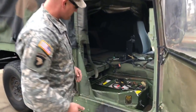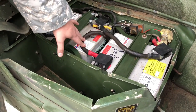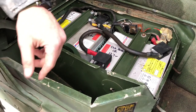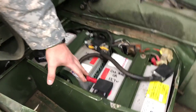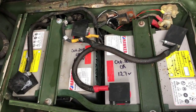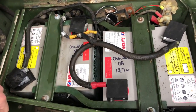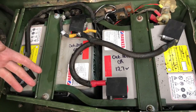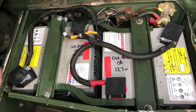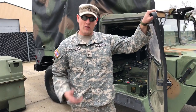Now we can get to the batteries. These are the military-style batteries — I'll link in the comments where you can find these. If you look down inside here, you can see how the battery cables are arranged. You can take regular civilian 12-volt top-post batteries and stick them in here just to get the truck to run and get it to move or pull off the trailer. Just stick two batteries in there, wire them in series, and you'll have 24 volts.